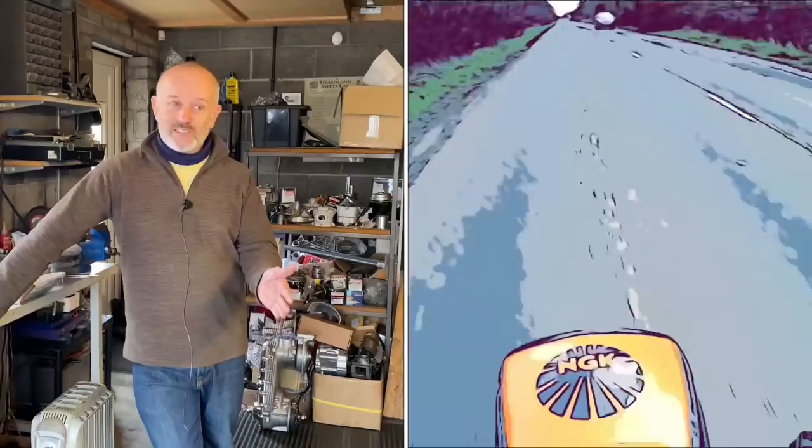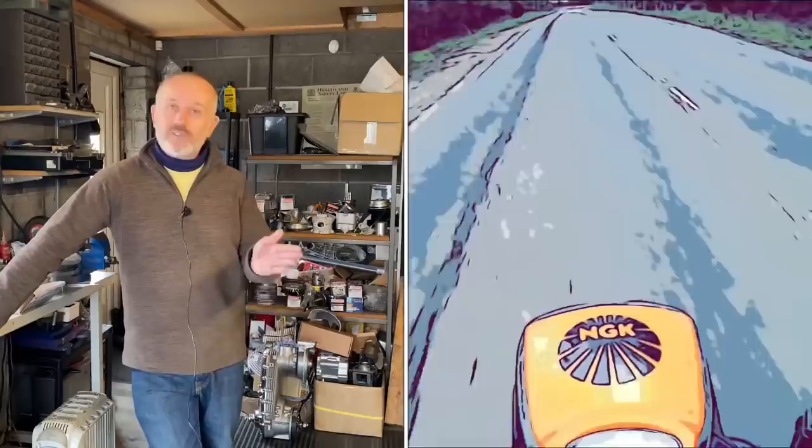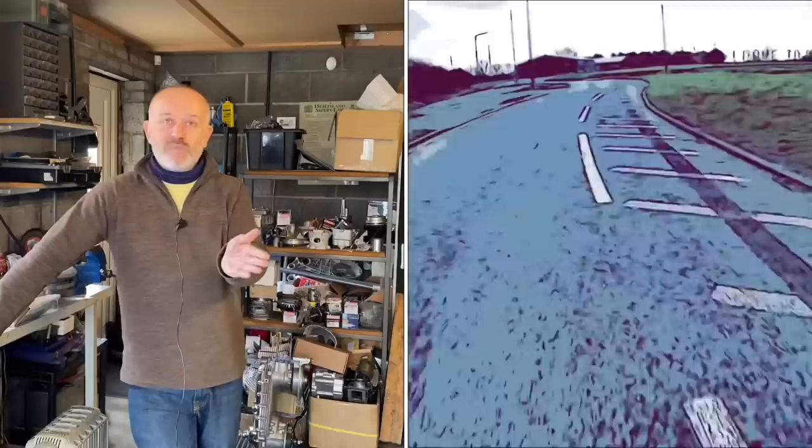And what you can effectively do there is select a lower gear and you're in sport mode effectively. And if you're the type of guy who just likes to cruise, then just chuck it in a tall gear, like you would do in a diesel, and short shift it through the box: first, second, third, fourth, fifth. And you'll be sat at fifth at 30 miles per hour and you can still wind it on and have good results from it.